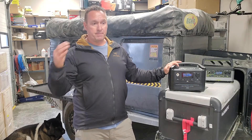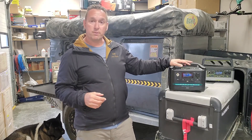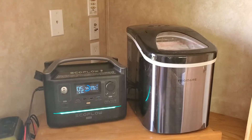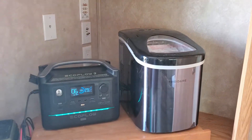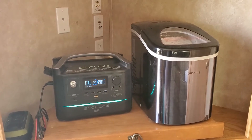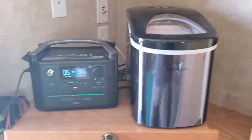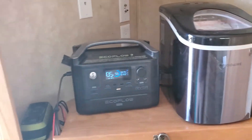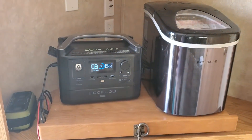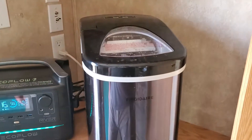Keep watching — I'm going to show the ice maker running while powered from our 120 watt solar blanket. I have to say, I'm very disappointed. I wanted to compare all three: the Goal Zero 500, the Jackery 500, and the EcoFlow River Max. All I wanted to do was run the portable ice maker. The EcoFlow is running beautifully — the AC ports are rated for 1200 watt surge, and what I saw on the screen was this little Frigidaire ice maker drawing just over 1000 watts when it initiates.